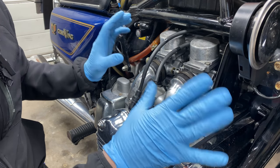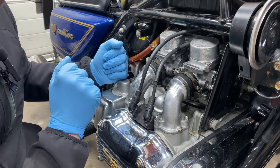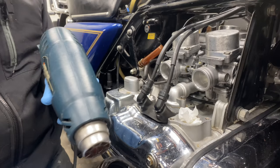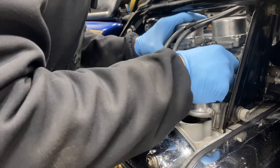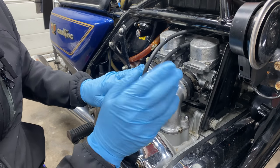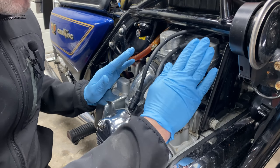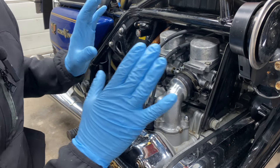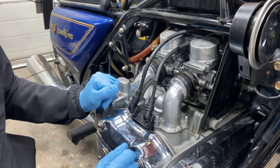Get all these bolts nice and easy to open and close - that will be a wise thing to do. When you put everything back together, it'd be smart to heat the intake boots up with a heat gun, which will make it easier to put them back on. Also, these are carbs one and three, the other ones are two and four. Try to keep everything separated, so everything you take off from carb number one you keep separate from carb number three, because all these things are meant to be on their specific carb only.